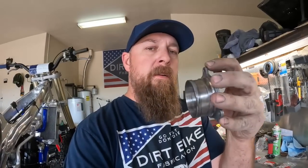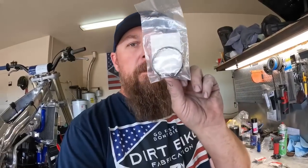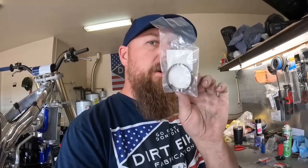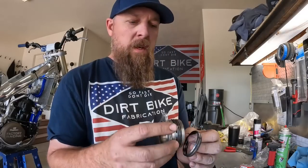What you do is bolt this side right here to the cylinder, just like it's supposed to be, and then you take the factory exhaust gaskets and double those up, and then double them up right here. The exhaust pipe slides onto here and gives you a nice tight seal without any leaking, and it still gives it some room to wiggle around. So never use silicone on these, just use the double gasket technique. Just like that.